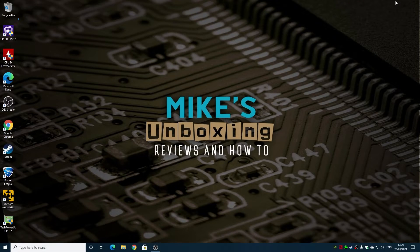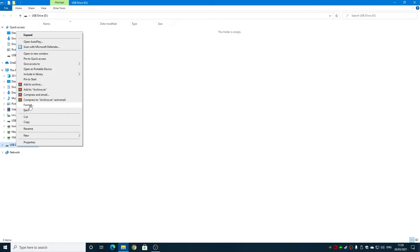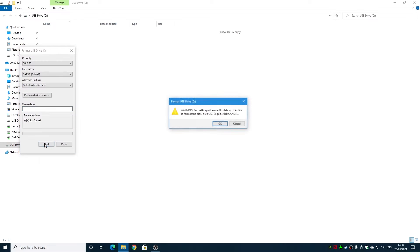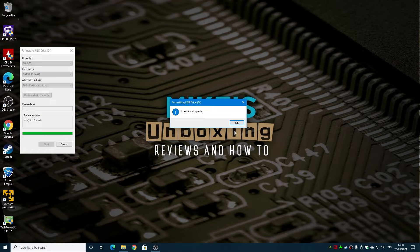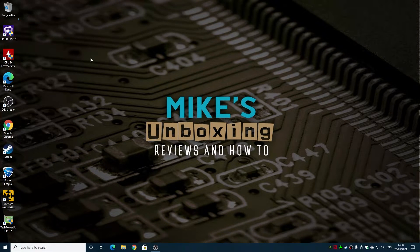We're on a Windows 10 desktop and I'm going to insert my USB drive into one of the front panels. Always good practice to go in and format the drive — make sure it's FAT32, that's really important. The allocation unit size you can set to default, make sure there's nothing in the volume label, and perform a quick format. Click Start and there we go — the format is complete, so our USB drive is ready to go.